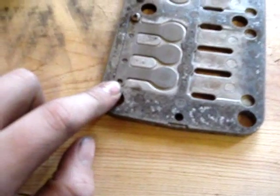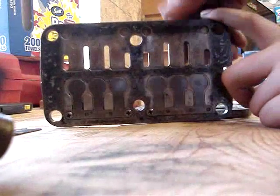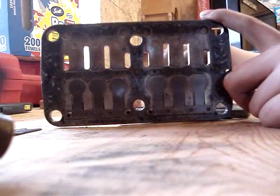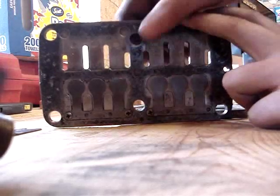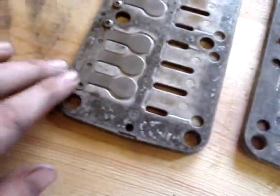Here's a closer look at the reed valves. I actually broke the screw when I was trying to get it out so I could clean underneath them. But it doesn't affect it because this one sits right on top and the screw head sits in that hole and pushes down on it, so it'll work. If you look here, the air just comes up through the hole and pushes up on the valves. When it's doing the other stroke, these get sucked down and pushed tight against there so they can't let air by. They have a very good design — some two-cycle engines have stuff similar to this on the intake.